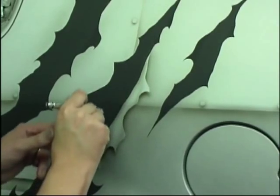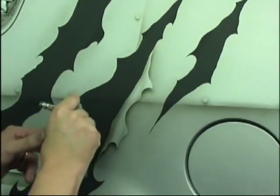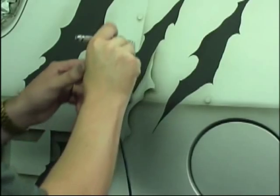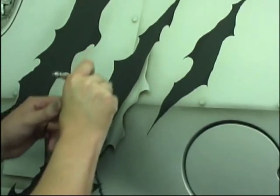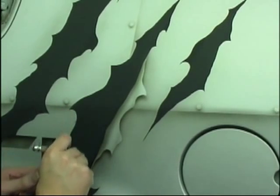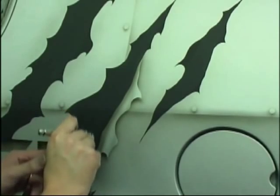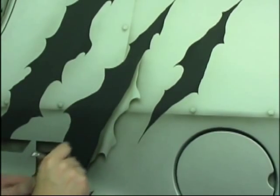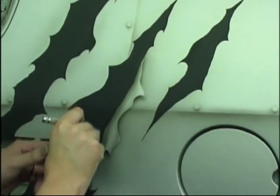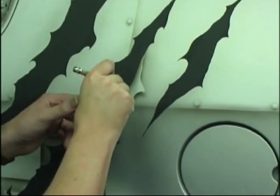You see, even with only ten or fifteen percent reducer, this paint is incredibly transparent — it's very very refined. What that does is it lets me build it up in stages, just build it up and build it up to achieve the desired effect I'm after. If I was using a semi-opaque here it would be very unforgiving and I would reach coverage far too quickly. The transparents are much much more forgiving.